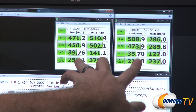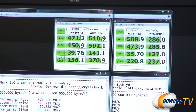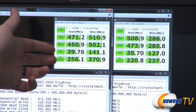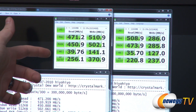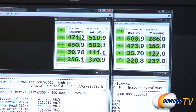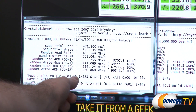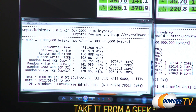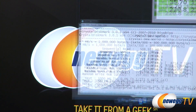Again, really solid numbers on the 4K tests. 4K tests are a good indication of typical day-to-day computer use if you're buying this for a home computer. With queue depth 32, which is a synthetic test to see how fast the drive can go, we see the raw results in IOPS. On our 4K queue depth 32 test, we actually hit the 90,000 IOPS result — one of the specs listed on the retail box.